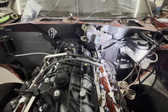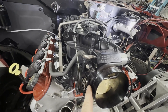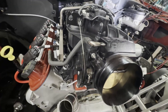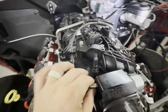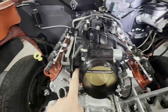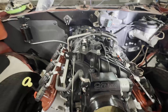Okay, here it is. Intake's torqued down, throttle body's installed, and we've got our fuel pressure gauges back here. Starting here — I did get my seal inside. It will not drive all the way flush, so don't try to beat it all the way flush. It'll stick out probably a sixteenth, maybe a little more of an inch. I did use some 680 Loctite — it's for bearing mount surfaces — on this vent tube here to kind of lock it in place, because it does slide around on these Amazon or eBay throttle bodies. I'm hoping that will cure the vacuum leak and the whistle I hear about online. I've never experienced it, but we're going to try to head it off at the pass before we get there.